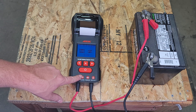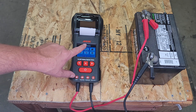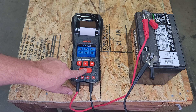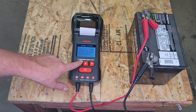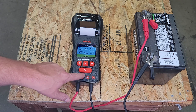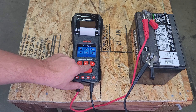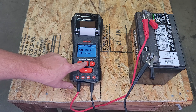You can see I've already set the date and time up here at the top. We're going to be at the main menu. Battery capacity is the main test. It also has a cranking test, which I clearly don't have hooked up to a motor, so I'm not going to run that. Charge system — you can have your loads and run the motor up and see that it's actually charging correctly, which I can't currently test. Data review will show you the results of the last test, which I've run on this battery, but we'll come back to that. Language set — we're already fine for English. And time and date adjust — I've already set. Very simple; you can use these buttons to select and enter.